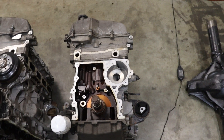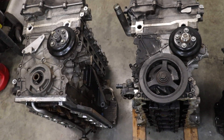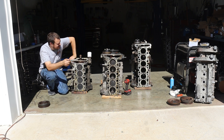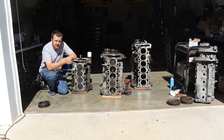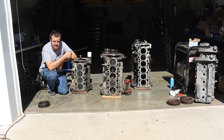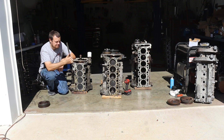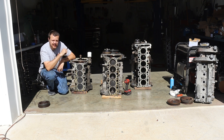Moving to the front of the engine, they are pretty much identical across the board. They all have the same front timing chain cover with the oil pump integrated into it, same water pump, same timing chain assembly with all the same shoes, and same camshaft sprockets — except the 4- and 5-cylinder had a 4-tooth exhaust cam sprocket across the board, whereas the 6-cylinder only got that in 2008. We've proven this timing setup is good for in excess of 8,000 RPM, and guys in Competition Eliminator have taken that same stock timing set to over 10,000 RPM — so you have something that is very robust and ready for some RPM.